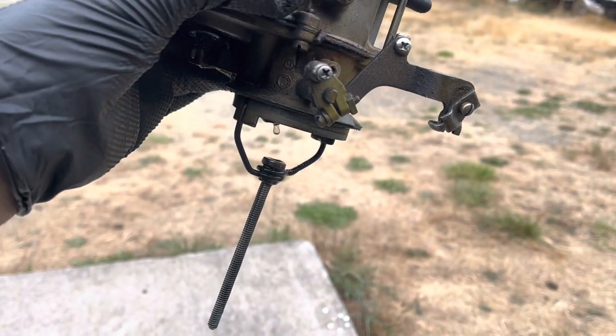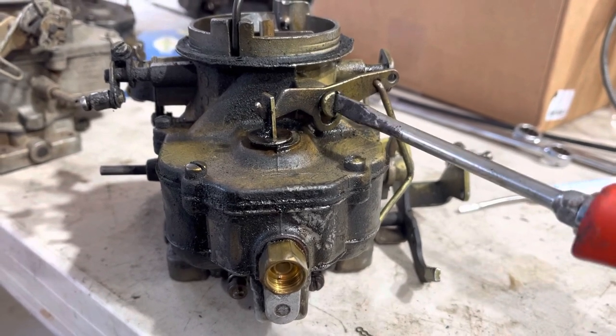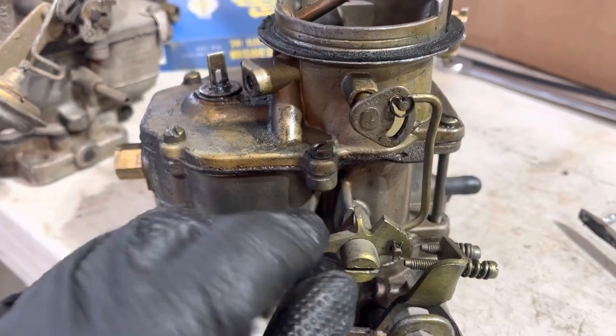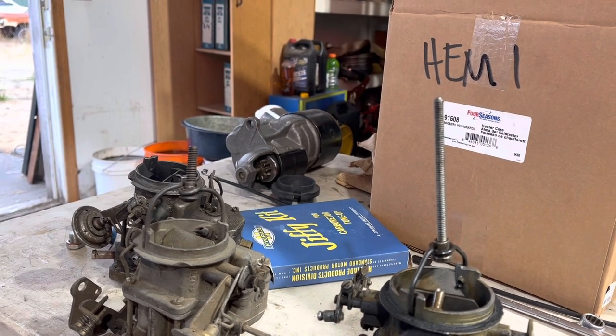There's some orange in there. This screw, like the carburetor mounting hardware, was loose. That's a problem. Need to pop this choke linkage apart as well — that clip should be sufficient. It's not the size of the air cleaner stud; it's the motion of the oil bath.